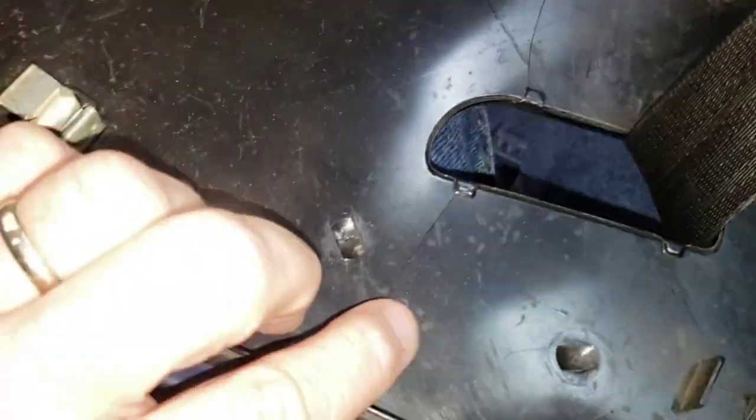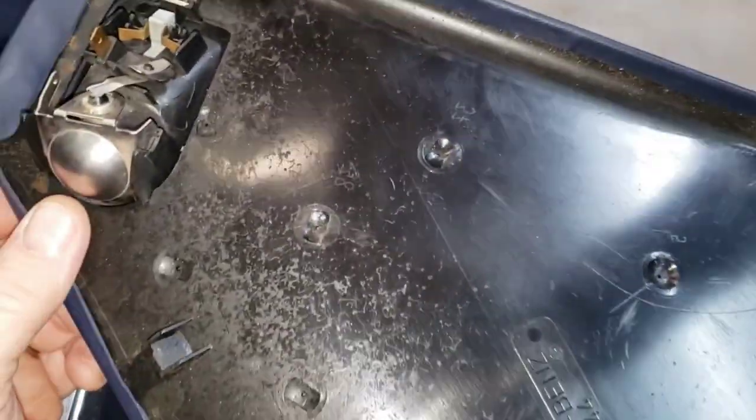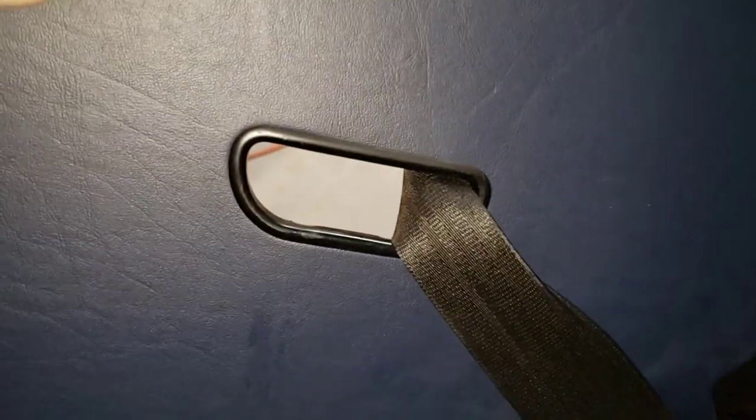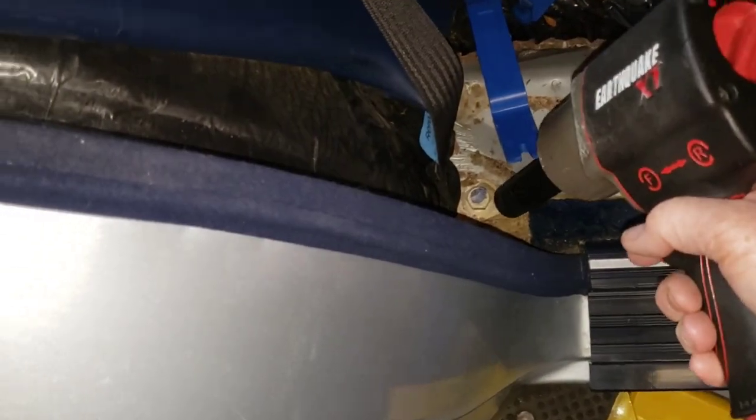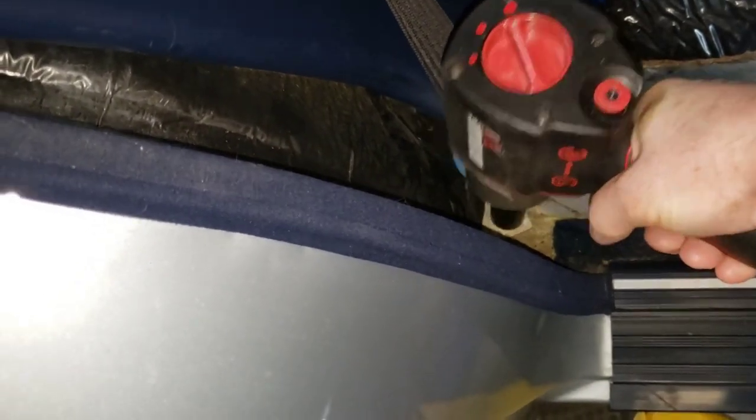The C-pillar is broken — some previous owner cracked it right there, and this huge piece has come off. This thing is just in horrible condition. That means we'll have to pull out the magic juice we've been using to repair the rest of the plastic on this car — we'll have to rejuvenate and reinforce all of this before we reinstall it. We've also got to disconnect the seat belt from the bottom with a 17 millimeter.